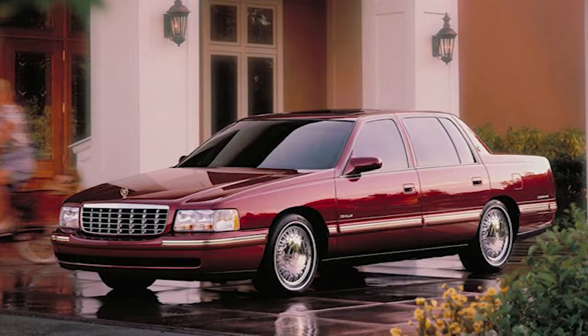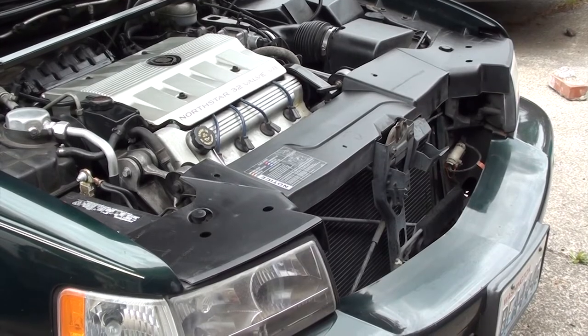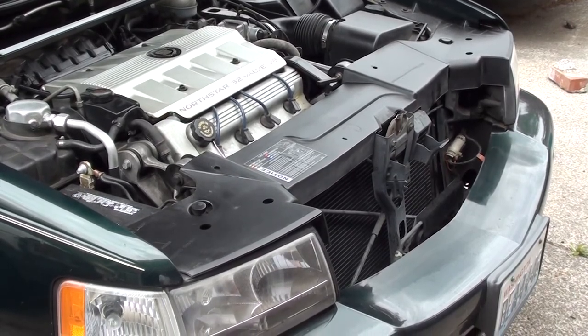We're looking at an engineer drawing of a fan. In the upper left corner, the arrow points towards the front of the car. You can see the four screws the red arrows are pointing at — remove those screws, then slowly pull the fan upwards. The fan slides into two slots at the bottom. The two red arrows show the plugs you need to unplug before you can remove the fan completely.